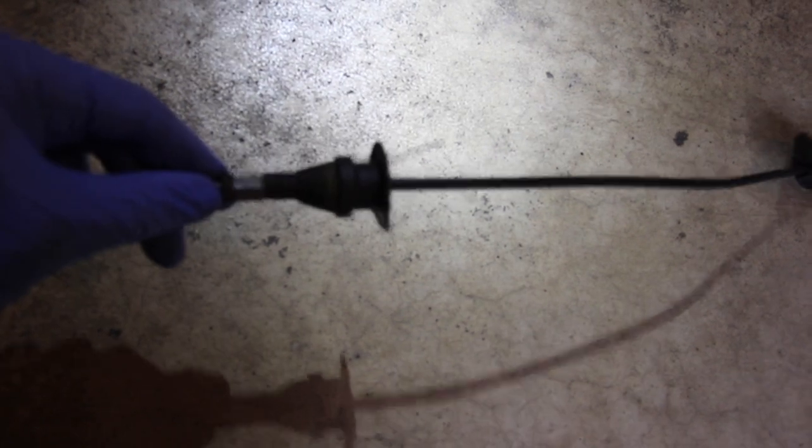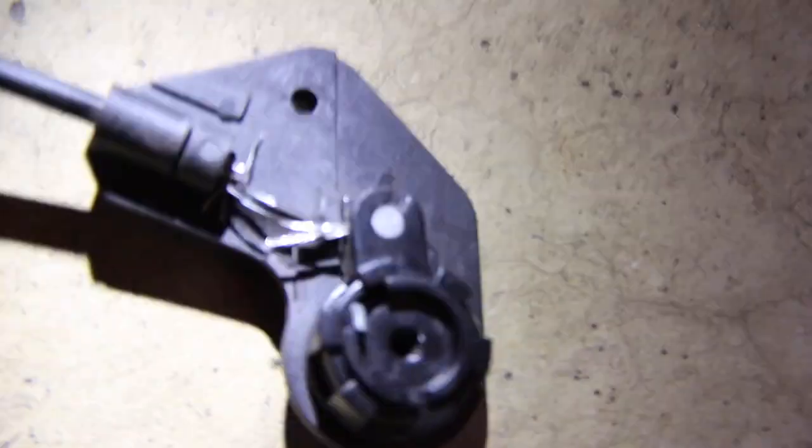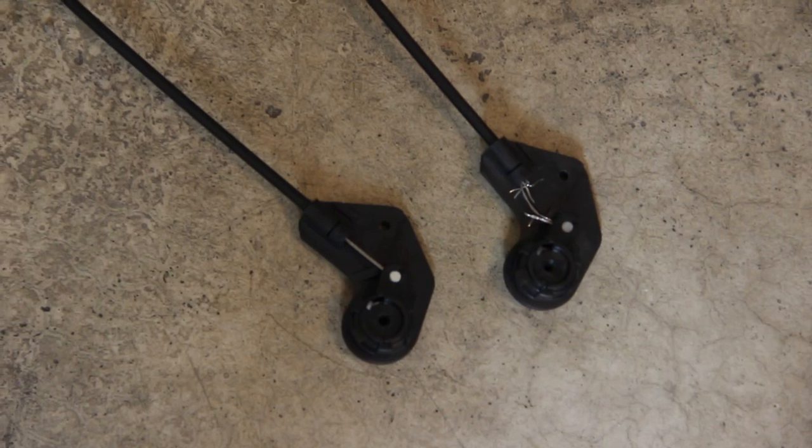Here's the old piece — pushing it through the firewall is a little easier said than done; it's pretty tight. This is the end where the handle was, and we came under the hood with a big flathead screwdriver and started pushing it into the cabin through the hole in the firewall. Once you get that piece of metal through, that's how it's installed — it's supposed to fit through there, you just have to force it. And we can get a better look at this frayed cable — that is days away from snapping. There are maybe two pieces of metal out of 10 to 15 that are supposed to hold that.